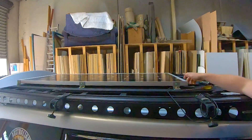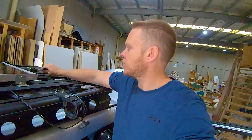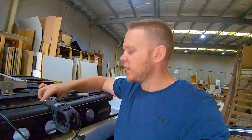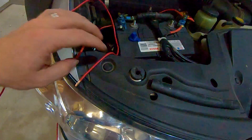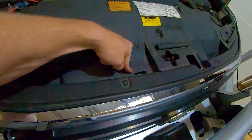I've got the solar panel mounted up properly now — been mucking around a little bit. Just done a bit of temporary wire; I wanted to make sure what I was going to do would work before recording it. Out of the bottom of the solar panel, I've got the original two fittings coming out to the Anderson plug. From there, I've run a wire that comes underneath this section, underneath the weather shield — just a single wire — runs all the way down, comes out underneath the bonnet here, tucked up from underneath the weather shield, into some conduit I've put in there, running it through the weather seal, and it's coming out the front. I've just got a loose wire for now that I'll run all the way through to my Redarc at the front of the car and wire it in.